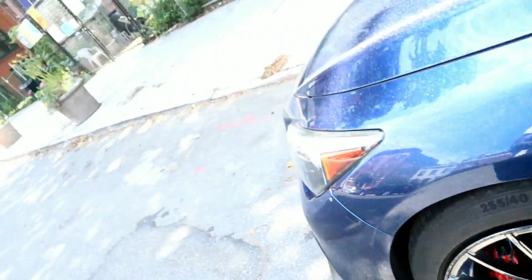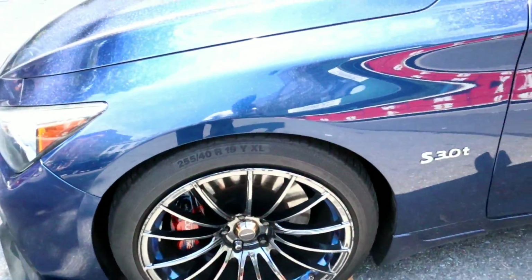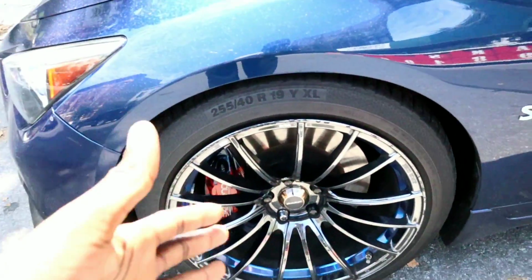Reason being is, I used to be a tire technician for a BJ's Wholesale Club, so I was trained by Michelin years back, and load index doesn't mean that the tire will withstand potholes a lot better, but what it does mean is that the tire can take more excessive pressure and or weight. So they're basically saying, yes, the tire should be able to take more beating when it comes to excessive load. All right.